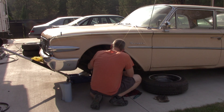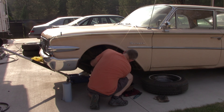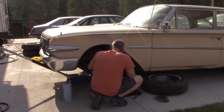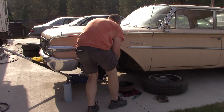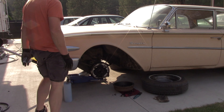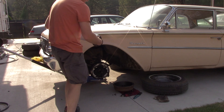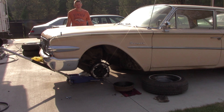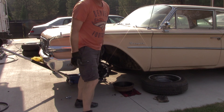Is the parts store up here still open? It's open until about 8 o'clock. This one actually has a self-adjuster, but the cable's missing and there's no guide. What's up with this — the pin's gone. And again, the shoes are on the wrong side. People, drum brakes aren't that hard. Will we ever find a car where somebody put the shoes on correctly on all four wheels? Looks like we're going to need a bunch more parts.